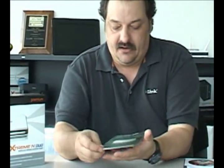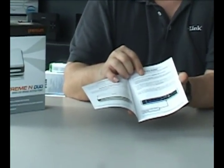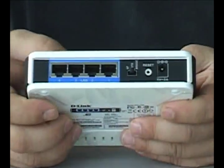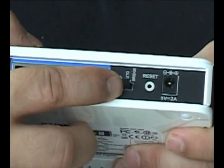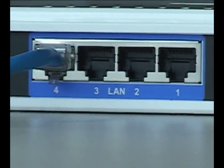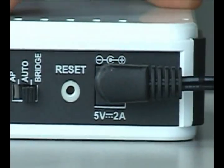If we look in the quick install guide, you'll see that the next thing we need to do is choose which position we want to put the switch in. For this installation we're installing the bridge, so we'll switch it to bridge mode — just move the switch over to where it says bridge. Now all we need to do is connect up the different cables and the power for the bridge, then we'll go through the installation wizard. Connect the ethernet cable from the DAP-1522 to your router, then connect the power adapter to the DAP-1522.